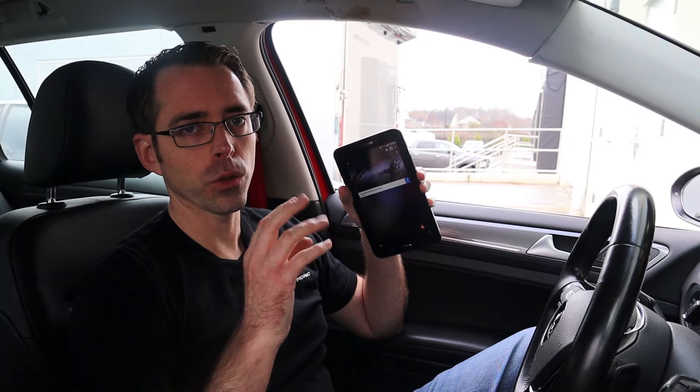After we did our steering wheel, we did have a fault in the steering angle sensor because we unplugged it from the vehicle. We're going to erase the fault with an OBD 11 and then we've completed this particular job. And there you have it — installing a steering wheel and steering wheel buttons on a Mark 7. We have around 160 videos on Mark 7 DIYs and related videos, linked to a playlist in the description. Purchases for parts like this help support videos like this one. If you like this video, be sure to give a thumbs up and subscribe for more.